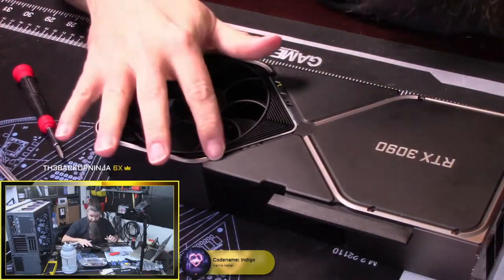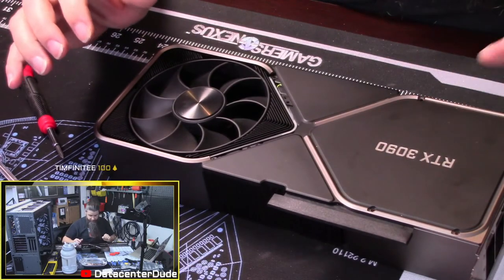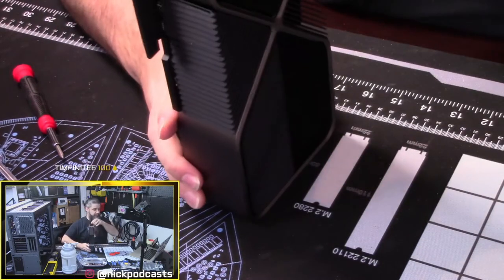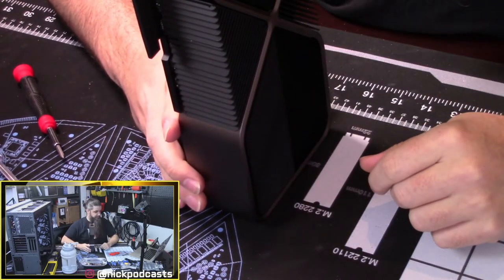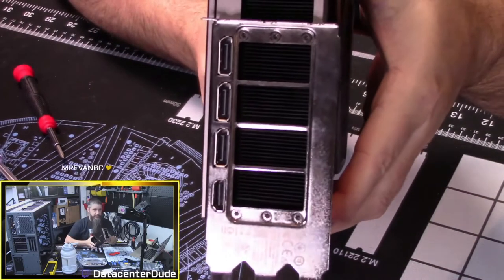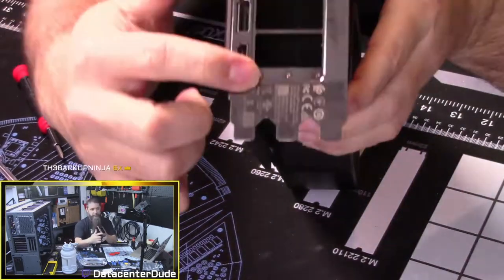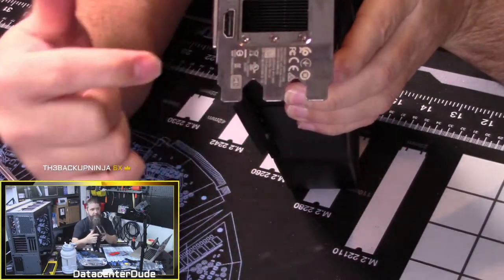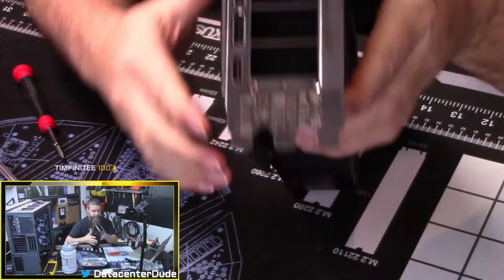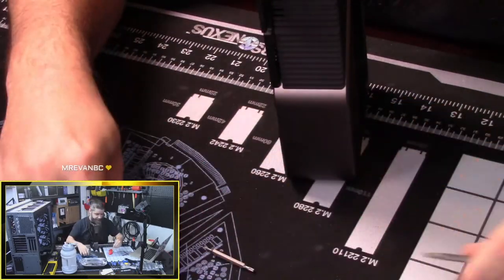So we've got these four out, we've got these four out, the SLI port is undone, and now we need to take the IO shield off. Let me make sure you guys can still see this. No, that's going to be off camera. All right, well, you can see that there's, and these are larger Torx. I think they're T8s. There's six of them, 1, 2, 1, 2, 3, and 1, 2, 3. So I'm going to just pop those off real quick. Yep. T8 it is.